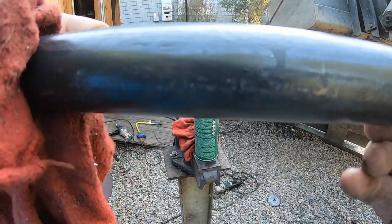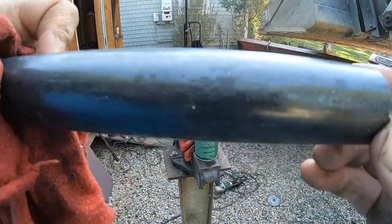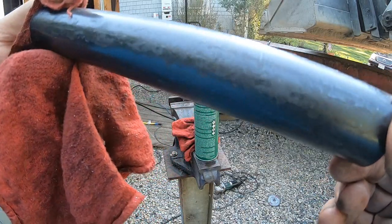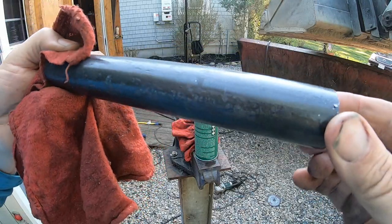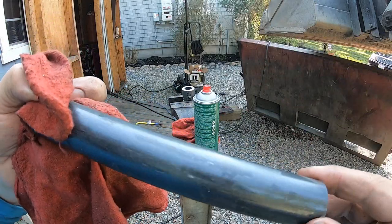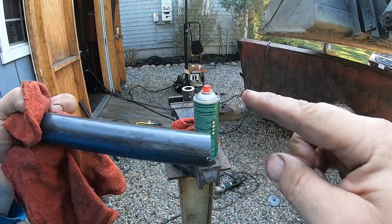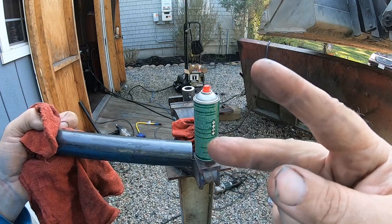Alright. You see all that stuff on the pin? That's all mill scale. Because this was, he called hot roll. Means it comes out with all this mill scale on it. Normally I get pin material that's cold rolled, and it seems cleaner. My mistake was I didn't clean this, and I think a bunch of this mill scale bound up in the thing. And the other thing too is I'm gonna hone out the inside, because there's burrs from drilling the grease fitting hole. That's another mistake that I did. So those are two mistakes I just made.